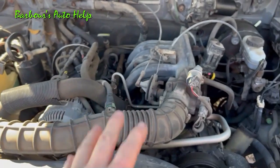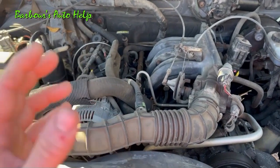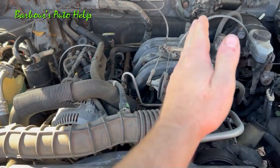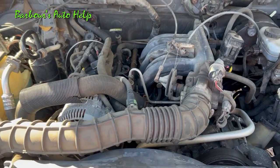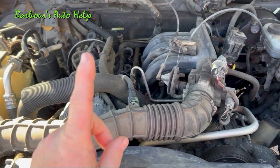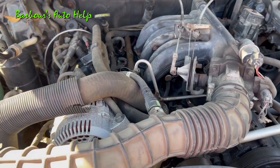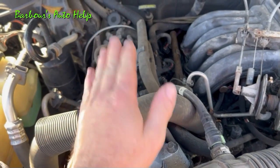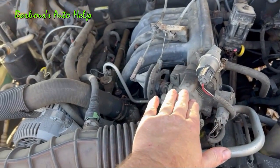That all changes when you have a V-type engine. This is a V-6 before me here, and this information will apply to V-8s and V-10s as well. When you've got a V-type engine, you have two rows of cylinders, one on each side of the engine. One of them is going to be bank one and one is going to be bank two. Bank number one is always going to have cylinder number one on it. In this vehicle, cylinder number one is located on the passenger side, so this row of cylinders is going to be bank number one, and bank number two is going to be on the opposite side.